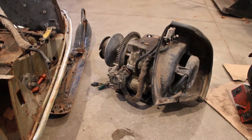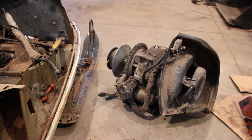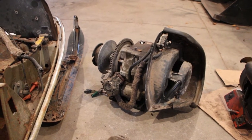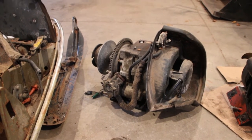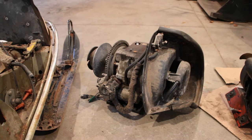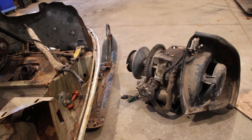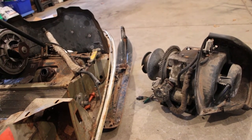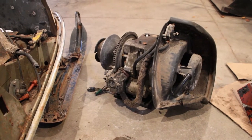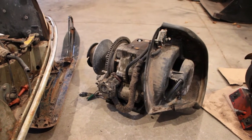As I learned more about these, they've got a bunch of different problems that need to be taken care of before you use the snowmobile for any period of time. The engines had, on the bottom side, a secondary air intake valve connected to the carburetor with a linkage. From what I understand, it didn't do anything for performance. What it did do was grenade a lot of engines because the hardware for the flap would come loose and get ingested by the engine — and obviously hardware inside any engine is not a good thing. So what we're going to do is plug that valve with, I think, an eighth-inch pipe plug.